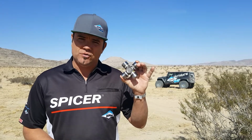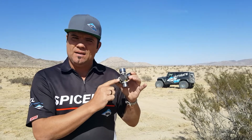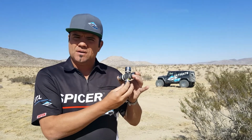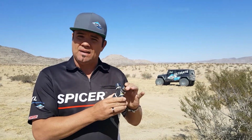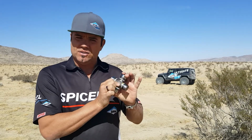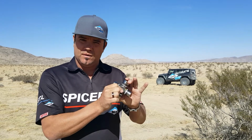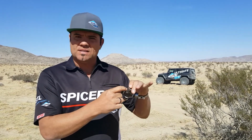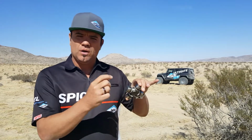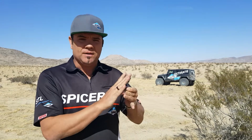There's two types of U-joints that Spicer produces. We have a 10 series U-joint that is greasable. So there's grease passages that run through the body so that the grease can go out to the cups where the needle bearings are, okay? Our SPL or Spicer Life series is a non-greasable joint. It's got a solid body, it's cold formed, so that makes it tougher, more durable than our greasable joints. There'll be a Zerk fitting probably in the side or in the cap that you'll see. There'll be a hole. You actually squirt grease into it and purge it, okay? But the SPL doesn't have those features.